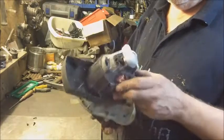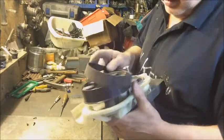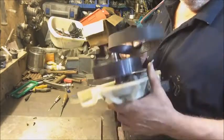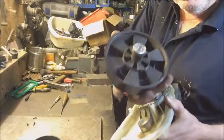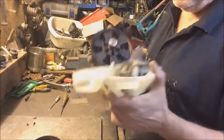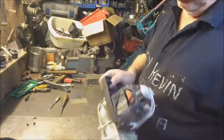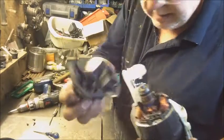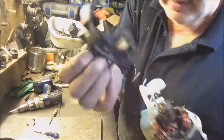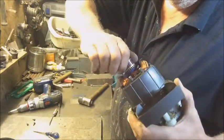Let's take all this plastic casing off. After a lot of prying and levering, it seems that it's just a push-fit bearing into that socket. Well, that is still rock solid. Let's take all that plastic casing off. The carbon brush is in reasonable condition, but that armature is solid - completely seized.